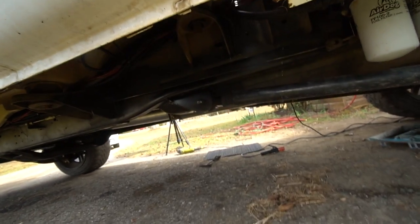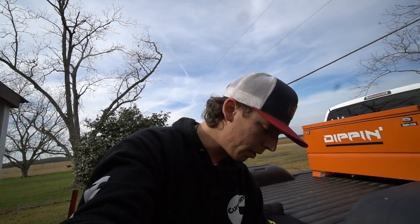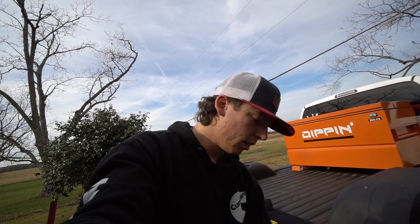I'm gonna go ahead and wire wheel this side because I did put some paint so it didn't rust. You can see this pitiful weld right here. I'm actually gonna turn the welder down just a tad bit so I don't get too much undercut. Try to control my bead a little bit better, and where I'm placing all my heat, so I don't get some undercut and blow through the frame. And yeah, without further ado, let's go hop on the other side and do that traction bar bracket.